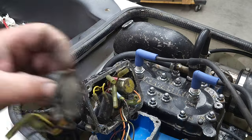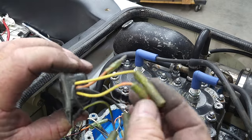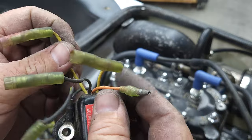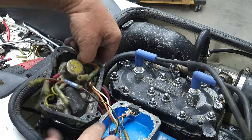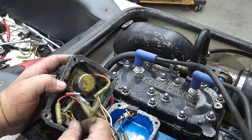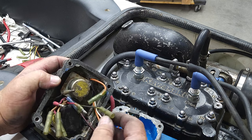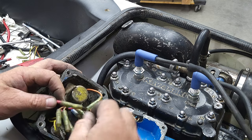This is our bad rectifier. We tested it and confirmed it — the power wire and one of the two wires is a dead short, while the other is like 1.2 mega ohms. I should not have assumed it was good. We found a replacement out of a 91 or newer, which has different wiring: two brown wires for the charging system go to our two yellow; the hot wire red goes to the orange starter relay; and it's only got one ground wire — the black with yellow lead. We'll abandon the other black wire and try it again.